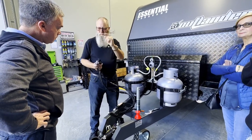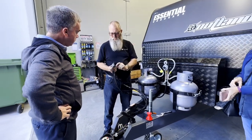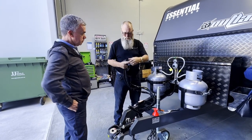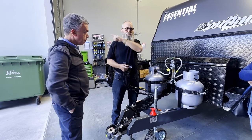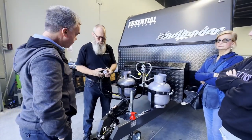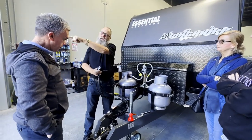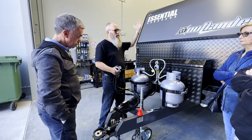Now, with that one, you have a monitor installed on your dash. On the plug there, there's a little groove. Line those up, mate them with the other end, push them on and screw them together. That's for the rear camera, so the monitor on your dash shows the camera. That one's your Anderson plug, so the charging system. It charges from your car battery through to the house battery whilst you're driving. So that's all the consumption.